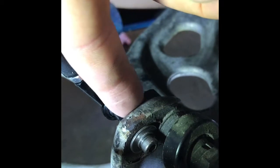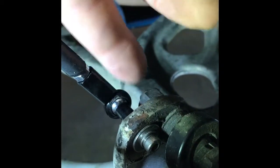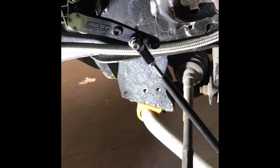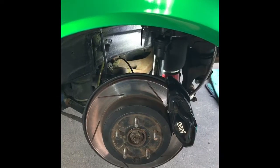I put a double spacer included in the kit, then a washer on each side including the back side. The double spacer is to ensure the sensor is under 15 degrees to ensure it's reading accurately. Right now this is in the full bottom position and you have to make sure you have your 120 degrees of swivel. The distance between the bottom of this nut and the top of this nut is five and a half inches.